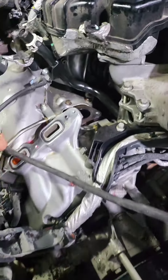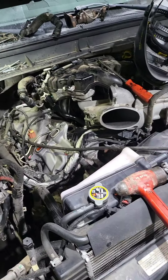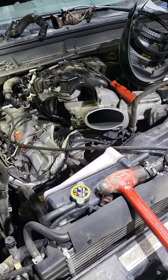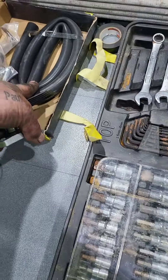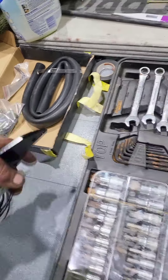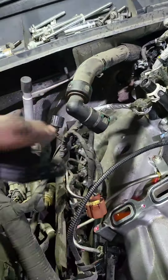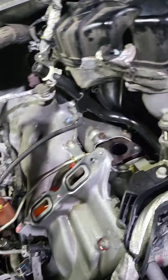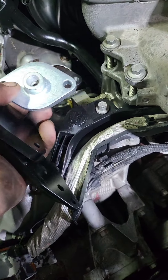I'm about to put it back together. Then when I pick the truck up and do the converter and the DPF filter, I'll bring you back and let you see what it sounds like. I got to put a cold air intake on it as well and put the Minimax Pro on there. These all go over top of the holes that are left open now. There's a hose, there's clamps, there's bolts to put this stuff back on. This continues the water line that used to go into there — it just reroutes it. There's a water line here that goes to that water line with that T piece. These blocks go here, here, and down there. The one that goes down there is the temperature one for the pyrometer, for the exhaust temp. I've got to take that exhaust sensor out of there and put it in the new location.